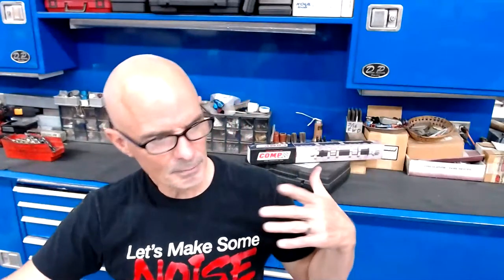Paul, the only thing that happens is you have to run less timing and you make less power. If you don't have E85 and you run it on pump gas, like I know with Matt over at Sloppy, he likes the 14 and 14 numbers: you can run 14 pounds of boost. I think he runs 93 because a lot of other states have 93. In California, we only have 91. But he runs 14 pounds of boost at 14 degrees of total timing, and that's the most timing it has. I need to ask him if he has less timing at the torque peak, which I would imagine he would. But that kind of gives you an idea.